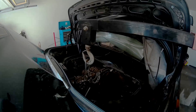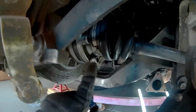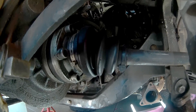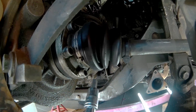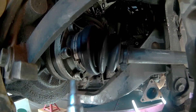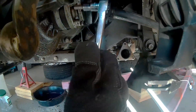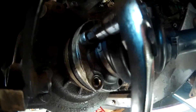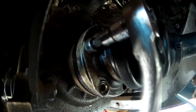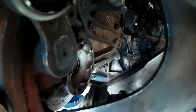That will support the engine while we do the rest of the work. Next, we need to remove these bolts from the axle. That is a number eight hex head. To take those off, put the car in first gear — that will lock it from moving — and then break them loose. You might need a breaker bar on hand to get everything loose.